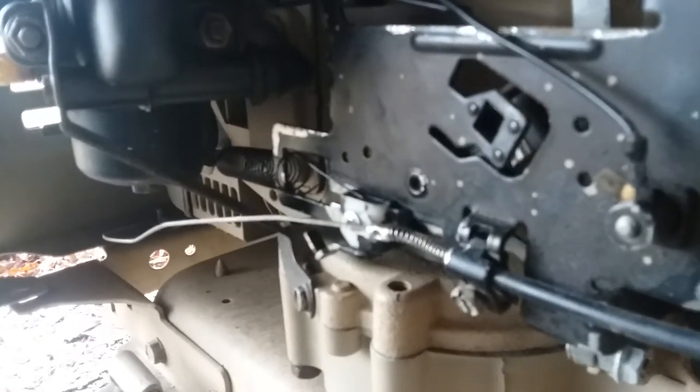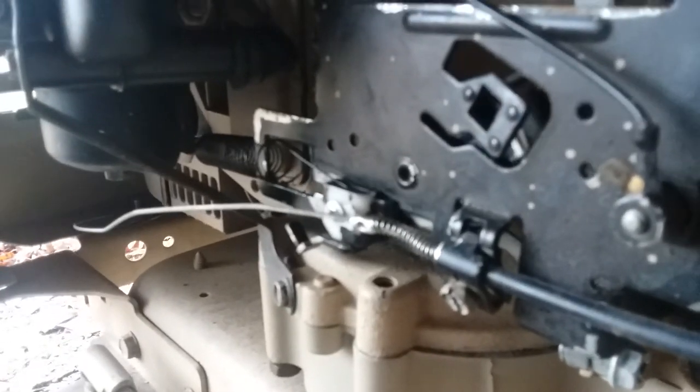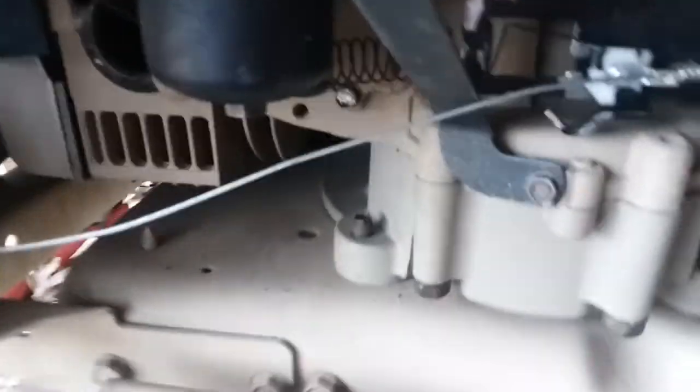I'll pause this for a second and see if I can get y'all a little bit of live action out of this thing. See how those springs are working together to do that. I haven't cut the cable yet — I just got it roped around back there, out of the way so it won't catch on anything. Yeah, that's pretty much how you rig up a gas pedal. If you like this video please give it a big thumbs up, and if you're stopping by for the first time please subscribe. Take care of yourself — I'm out.